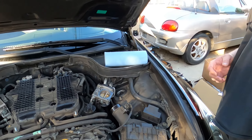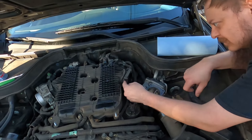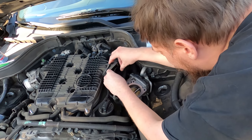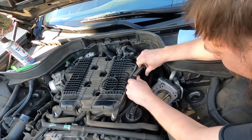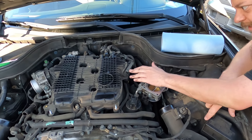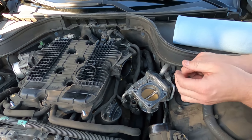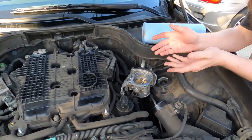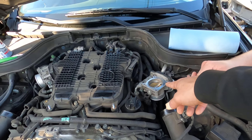Before we wrap up, here's the new gasket — it has a tab on the side. Look at the manifold and you can see the corresponding tab. Pull the old gasket out, line up the new gasket's tab, and put it right on. When putting these back together, note that the bolts go into a plastic bushing — do not overtighten, because it will break the plastic. Just be careful when tightening up.